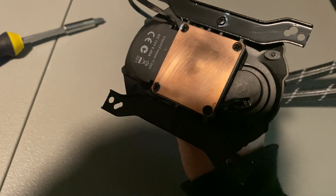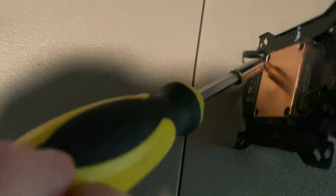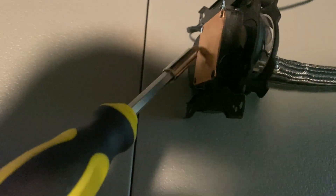Now what we're going to do is use a screwdriver — I'm using a Phillips Zero bit. This is extremely important: you do not want to strip these screws or you will not have a fun time with your AIO. Before you unscrew the cooler itself, make sure you organize the screws so you know where they go — like the bottom right one, screw that back into the bottom right. It does matter. You don't want to put the wrong screws in the wrong area.